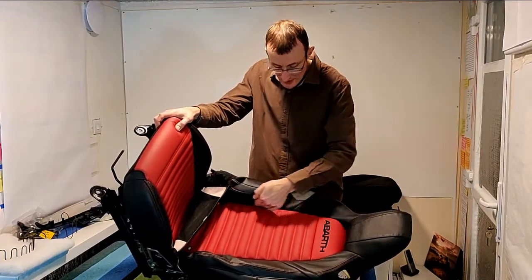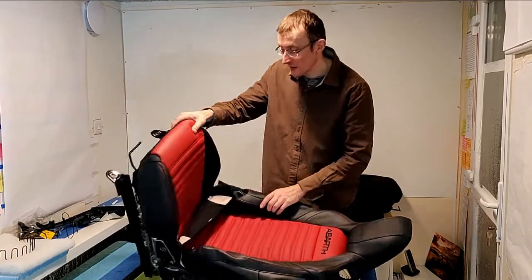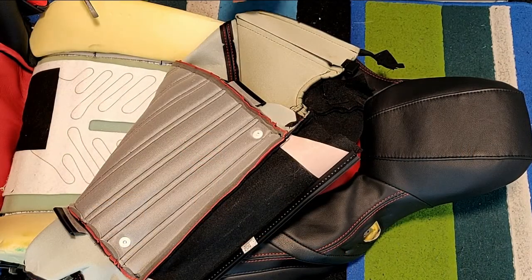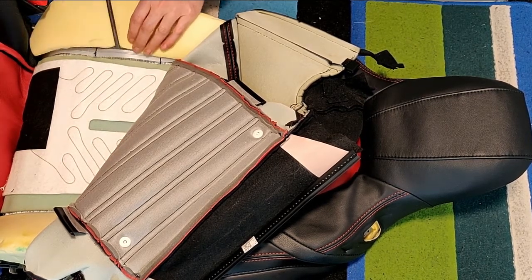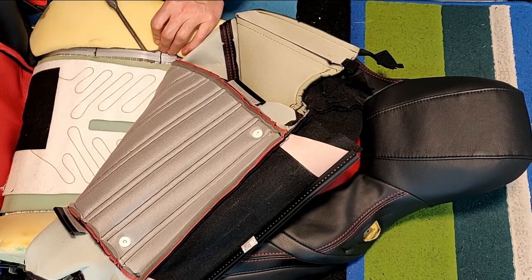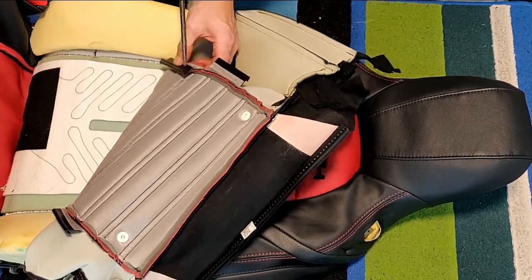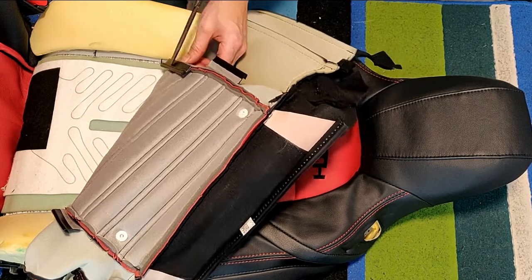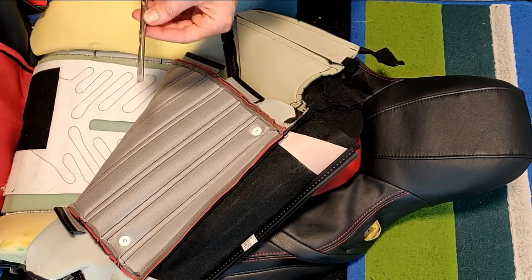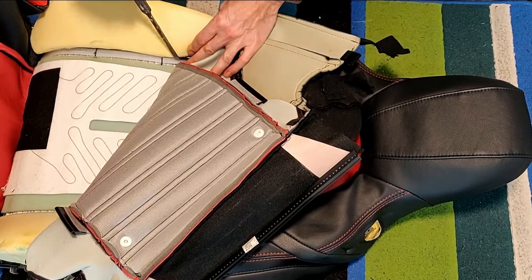Inside the seat, in the edges of the cover, there are some more J-clips, and we've literally just got to untuck those. So let's have a closer look at the J-clips fixing the seat back on the back of the seat. If I pull back this side bolster, you'll see this white plastic trim that's stitched to the seat backing. The J-clips sit underneath that, locking the trim into the curve of the clip.